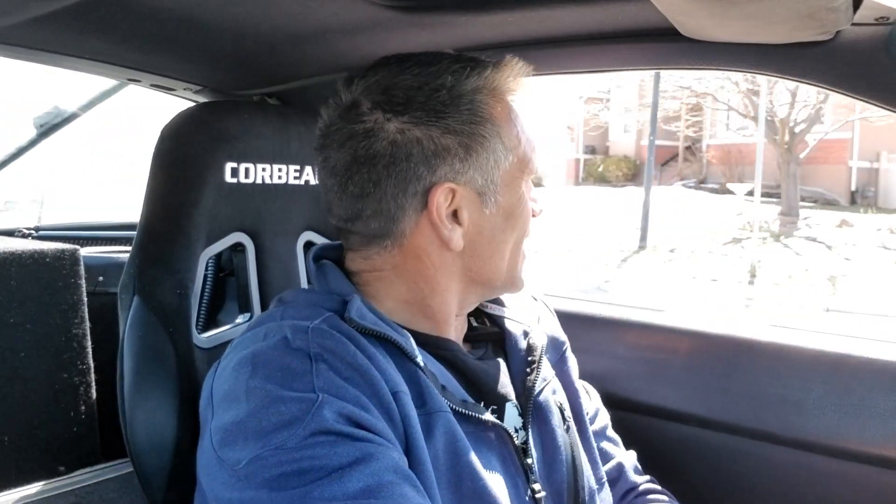I need to turn the boost controller off — it just went over 8. Now the boost controller is turned off, so it's just running on the mechanicals. That's vacuum — that's negative, and we want that to be around 7 or 8 at idle; even higher is better. It's the boost that we're trying to control.